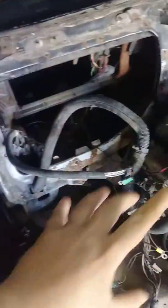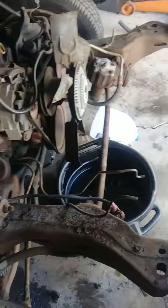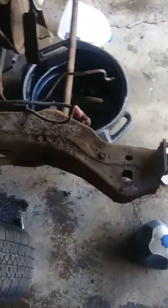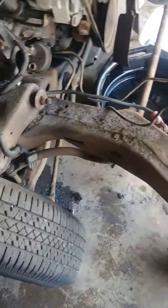This whole thing. Now, I also want to get that patch panel. I'm going to scuff it up with some Scotch-Brite pads, and paint that black also. But first things first, everything's getting covered in primer, even the frame rails. They're going to be covered in a high heat primer, so they're very durable, after I clean up all the sandblasting media that fell out of my fenders.